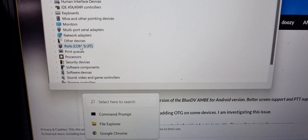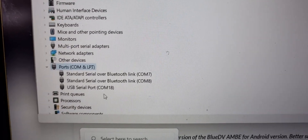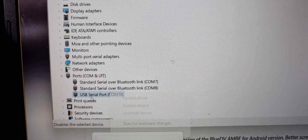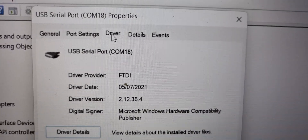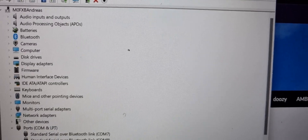Double-click Ports and there it is — USB port COM18. You do need the FTDI driver; I'll put a link in for the driver. Just double-click it, go to Properties, Port Settings. We haven't had to change anything, and there's the driver — FTDI. I'll put a link in anyway. So we've got it — we know it's COM18.